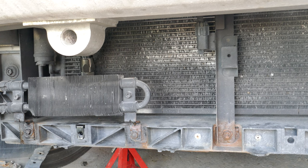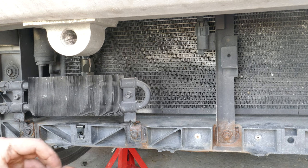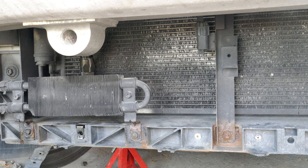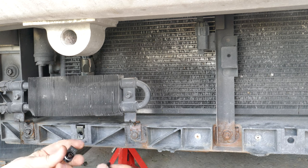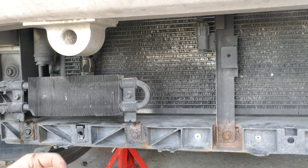I didn't know how this would attach specifically, but luckily, I do happen to have with me the under tray brackets. I don't know what you call them, like pins. And they come with exactly the same style of bolt as you can see is here. So it's just a washer bolt. You pin it inside and you just screw it in. Nissan comes with the ability to install these brackets. They just haven't installed the coolers unless you have a specific version of the, I think it's a Nismo or whatever it would be, which I don't have, so you need to put in coolers on yourself.